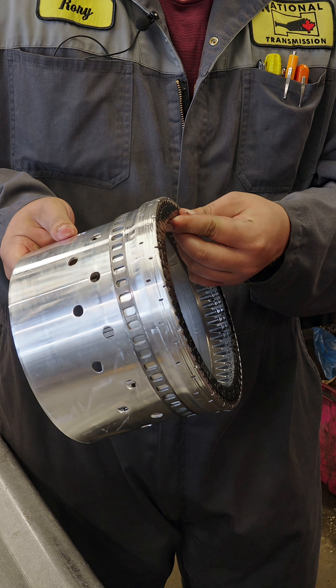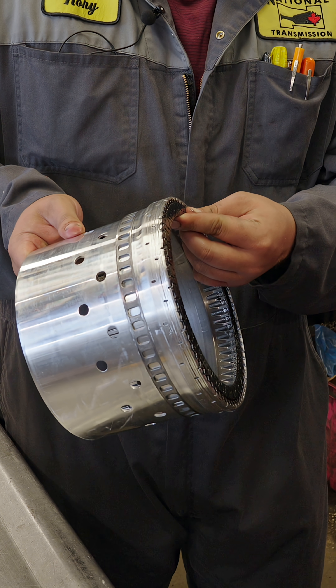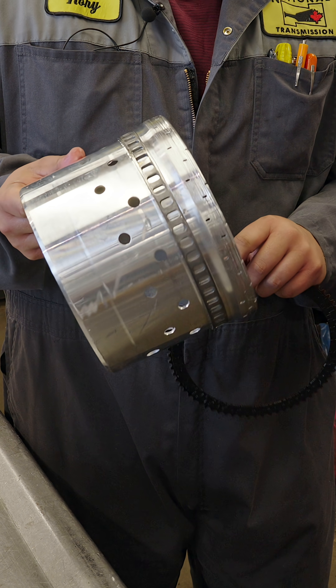With these indents, the clutches have more and more left and right play, and that will either prevent the clutch from fully applying or fully disengaging at times, which is what we're feeling with regards to our erratic shifting.